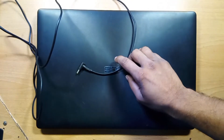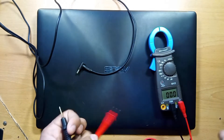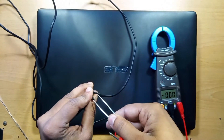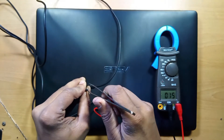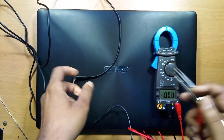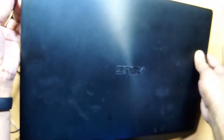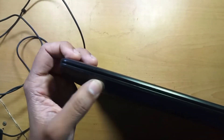The charger is plugged in. Let's check the charger. Here is the multimeter in voltage mode. And you can see we have 19V from the charger. The charger is plugged in and we have no light — here we have the charging light, but it's not glowing.